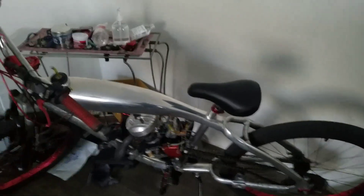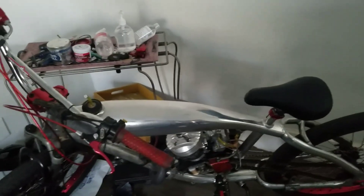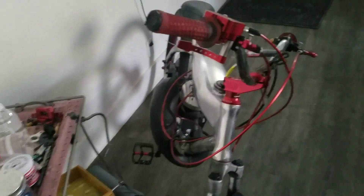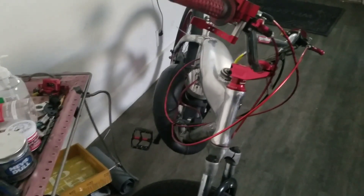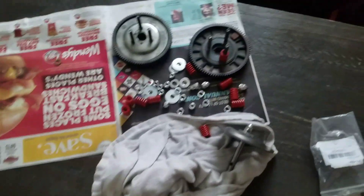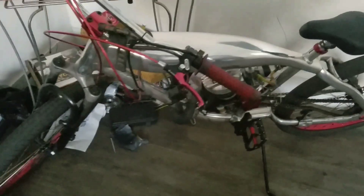I want to see if more airflow lets the engine reach its full potential — right now I'm tapping out at 52-53 mph but I should be hitting 65. Other people with similar setups are going way faster. When I built a pipe for my other bike with the minibike conversion, the pipe was restricting it. You need a less restricting pipe so the engine can breathe correctly. If you decide to build one of these clutches, leave a comment and show me a video — I'd love to see your super clutch!